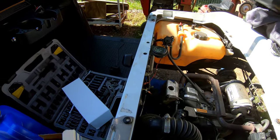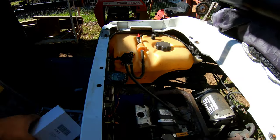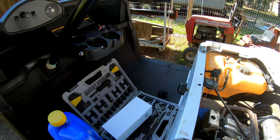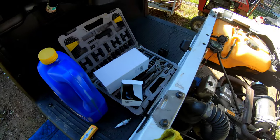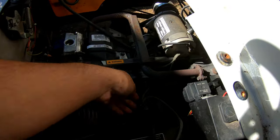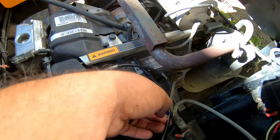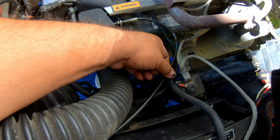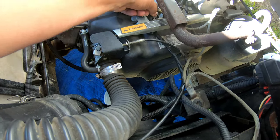The kit also comes with an air filter and an oil filter. Right now I'm just trying to change out this spark plug and get it switched out so it ignites a little better and fires up faster. I was in here looking and this cable is actually right up against the exhaust - I didn't know that. I also have a wire up against it that hasn't burnt through yet. What I need to do is take a zip tie and zip tie all this stuff together down here so it stays away from that exhaust. This is just my choke cable - I don't have to buy a new one. Checking all my grounds and wiring while I'm in here.